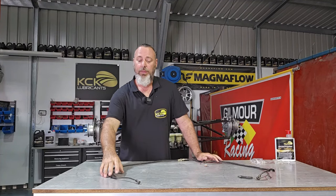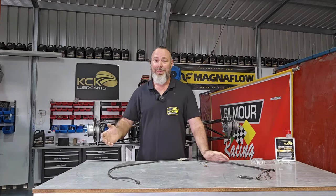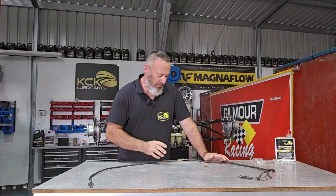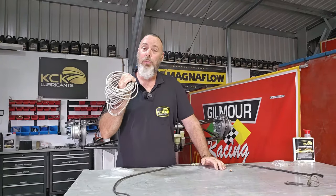It shouldn't see the service life that these brake lines have — they've probably been on it for a million years, so it's time to change them. We're not going to reuse them or the ends. We're going to remake all the brake lines on this car. I've got a roll of dash 3 teflon braid which hopefully is enough to do the complete car.